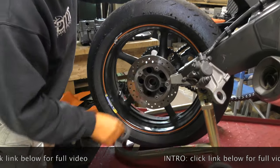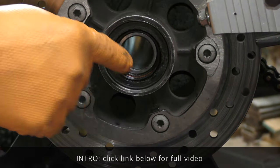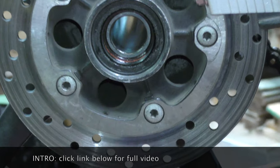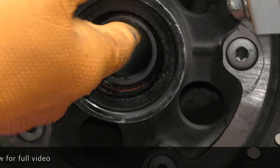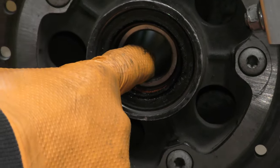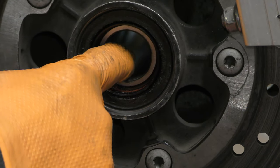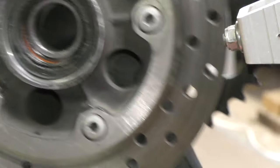Spacer out. Inside you can see the orange — it is a sealed bearing, and that is moving just fine. It's not lumpy or crusty, and there's no wiggle in it backwards and forwards. So that bearing is fine — that's all good.